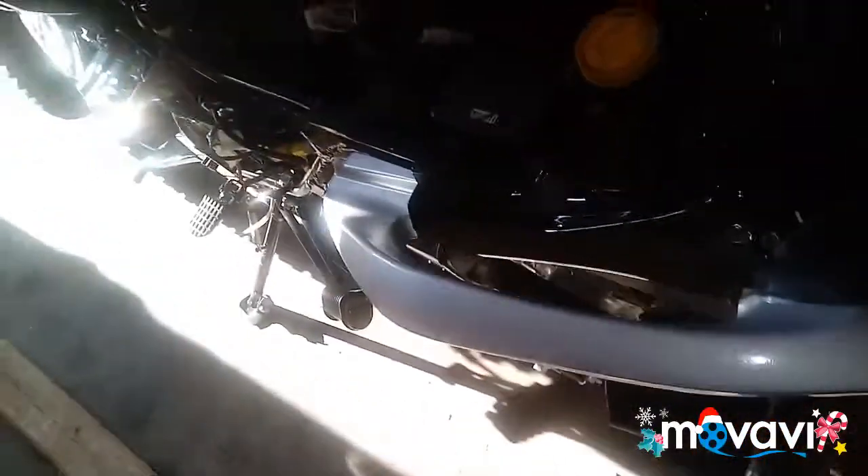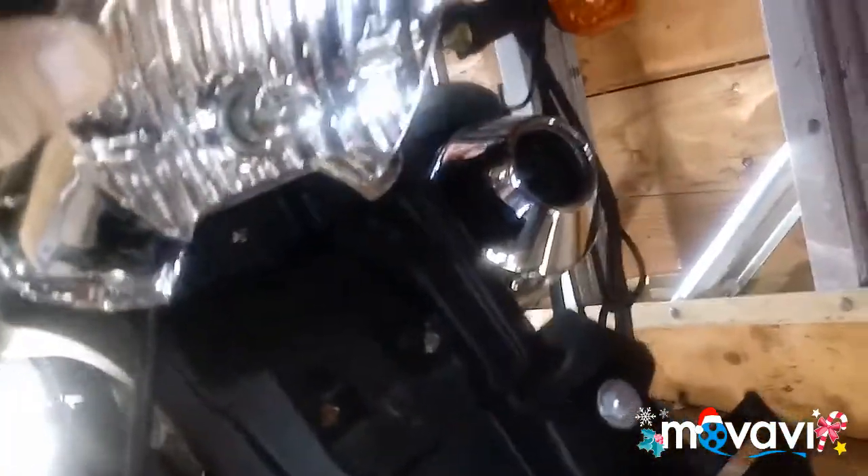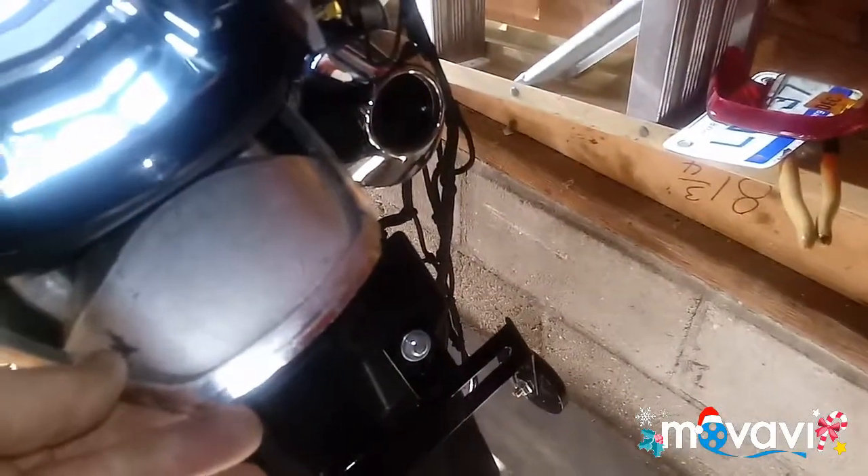This has been a very tricky one — trying to take off this tail light. It's got a plastic piece up here that holds everything together but I couldn't figure out how to get it out. So I took off the license plate light just to see what was under there — nothing. I then went underneath, where the seat would be, unbolted the handle rails, and reached in to get two nuts in there to loosen up the light casing and brake casing.